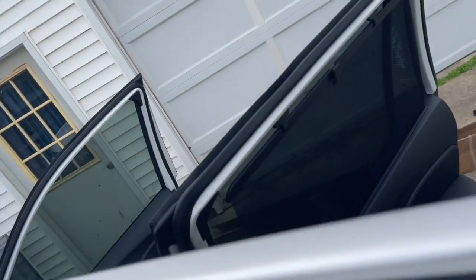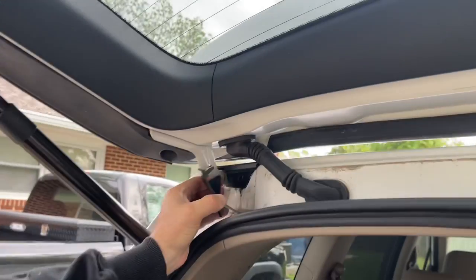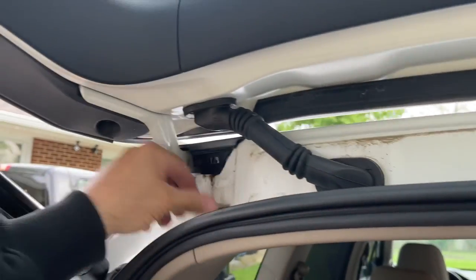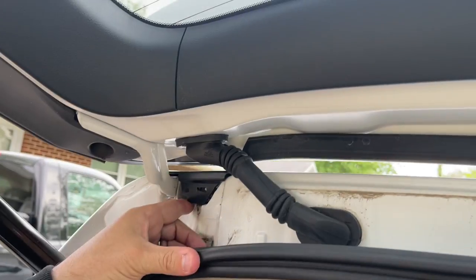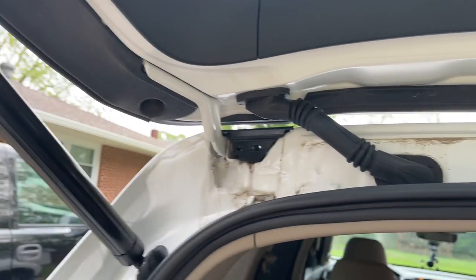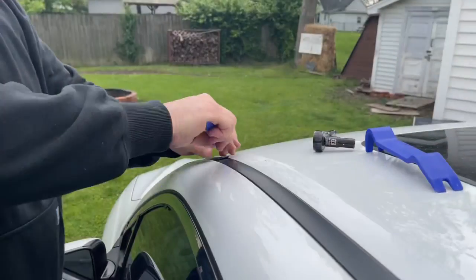You saved yourself $500 because they charge you an arm and a leg at the dealership to put these on. This is the opposite side — oh look at this, they had a little silicone. Don't tell me they're not cheating! I don't feel bad putting a little caulk on the other side. That rivet thing is going to be right up in there, but before we do that, we have to go up to the front with a 10 millimeter and remove that front piece. We're going to do the same thing on this side.